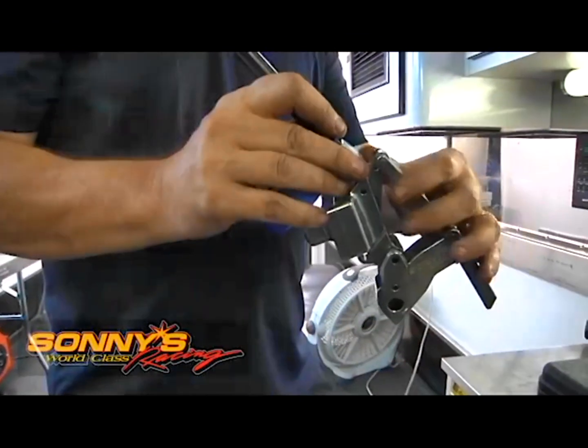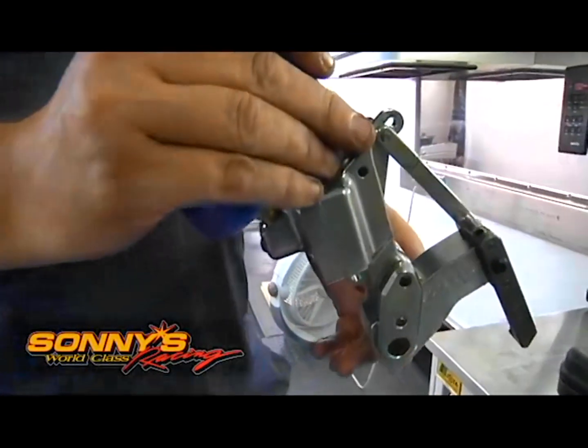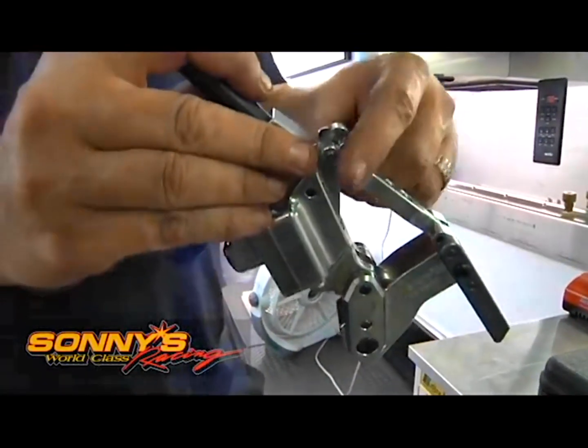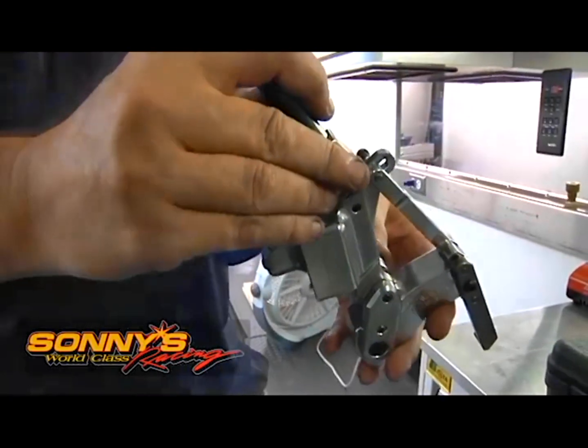It's got a quick little pin release here, so you can go from the intake to the exhaust using the same tool, and with the ratio difference on it, it's going to give you the correct reading.